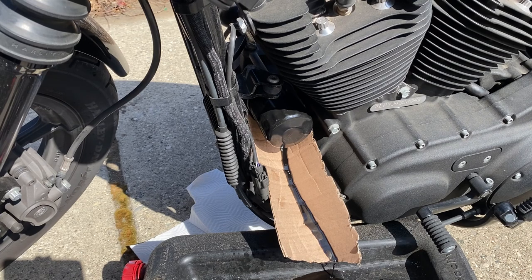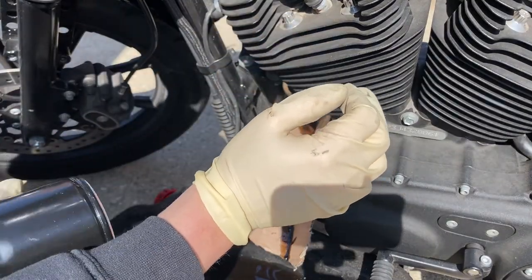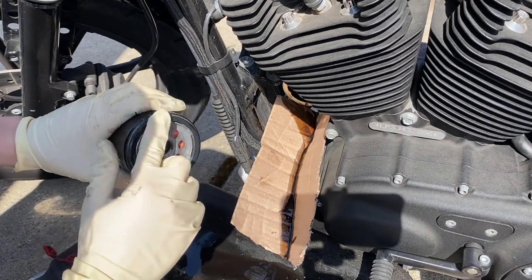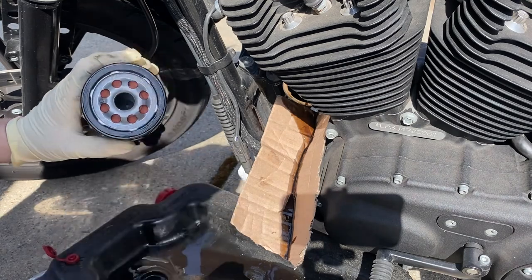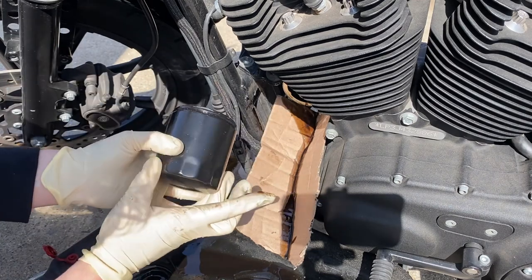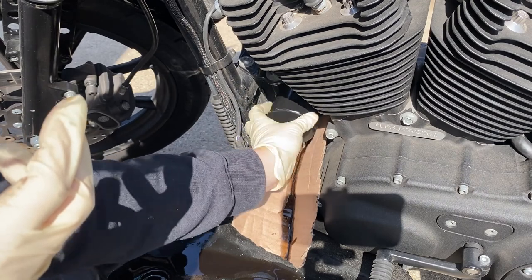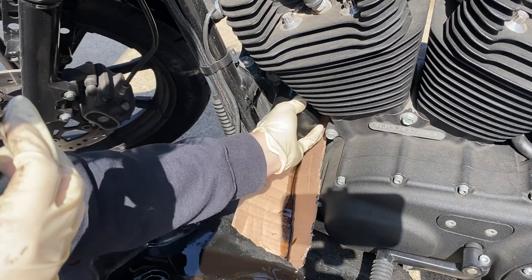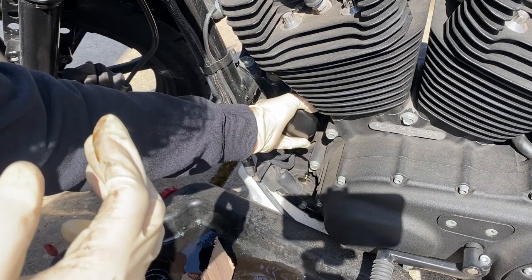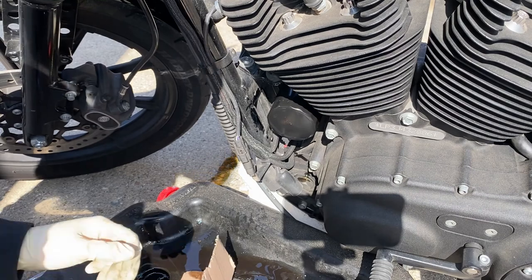I got my genuine Harley oil filter here. I'm going to clean that off — it's got a bunch of dust on it. I'm going to take a little bit of oil. Make sure you're wearing gloves — oil's dangerous. Lube it up a little bit so that the next time when you put it on, it ain't going to come off so hard. Give her a couple spins, put her in place, and give her a good tight down. You don't want it to be loose, but you don't want it so tight that you're never going to get it off again.